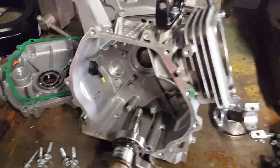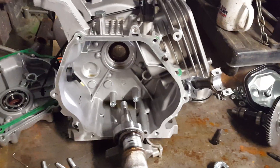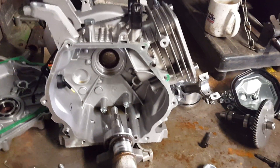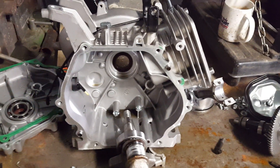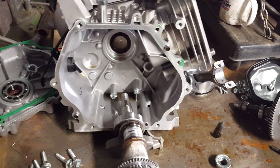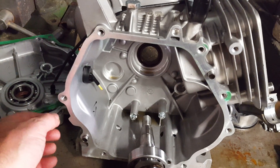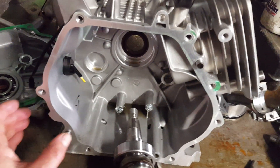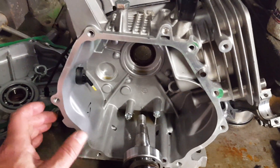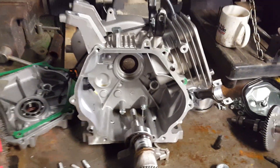The other problem was I was running too much oil. I had removed the low oil sensor, so I'm very diligent about checking the oil and wasn't worried about running too little. But I noticed it had used a little bit of oil, so I topped it up. Unfortunately I put too much oil in. When I removed the drain after it locked up, the oil that came out filled the bottom of two cut-off plastic water bottles before it was down to the normal level. I was running way too much oil.